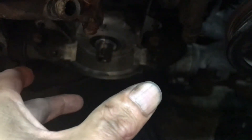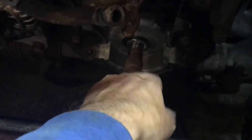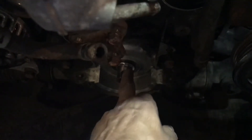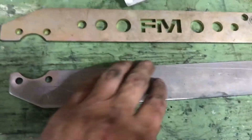It's supposed to be the crank bolt that holds it tight. So the fix is I've got a new Woodruff key, new crank pulley. The repair actually calls for lining everything up, twisting the crank pulley. There's a tool I borrowed — I actually ordered one and borrowed one. You hold it up against the good side and fill it in with Loctite 660. People have tried it with JB Weld and that held for a little while. These are tools to hold the crank — this is the one I borrowed and this is the one that arrived the next day after I borrowed that.